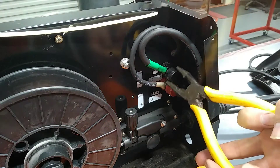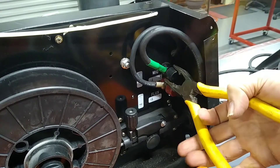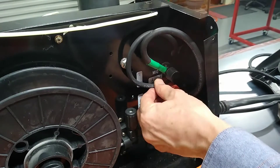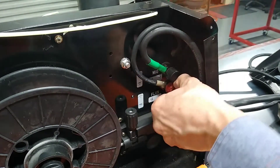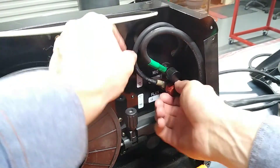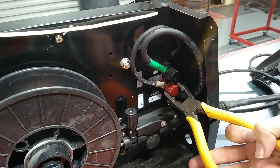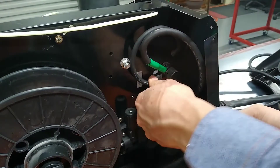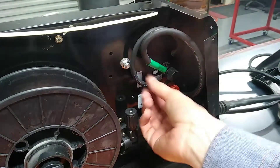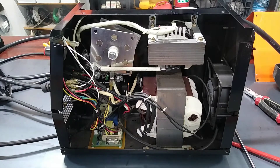Better not forget to reinstall those crucial flat washers. We'll just tighten up that thumbscrew with my pliers — we want this thing as tight as possible. Would have preferred wing nuts. There we go — that's tight. Oh — the positive terminal! That's no good. I did that up tight; obviously with the vibration of the fan it worked loose. That's a lesson learned — it might pay to check these terminals every so often. That's tight now.